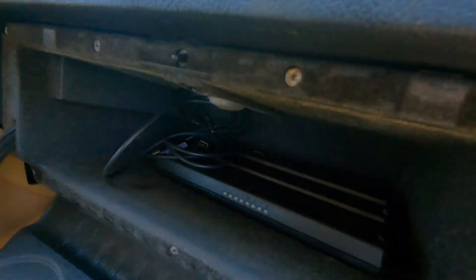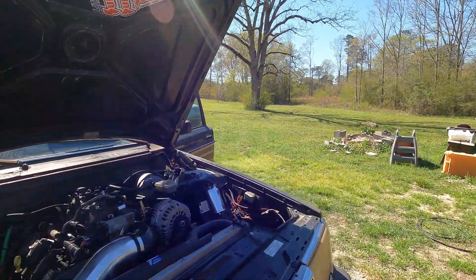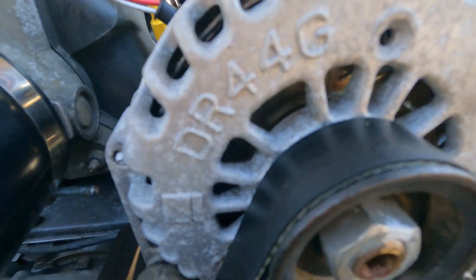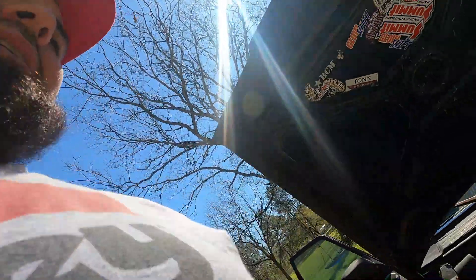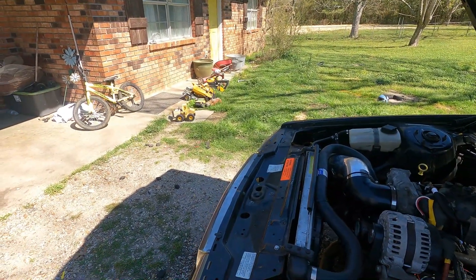One thing that a lot of people run into when they're running a system like the Holley Terminator — which is what I'm running in the car — maybe you're doing an LS swap and you have a Terminator setup, Terminator harness, but you still want to use the DR44G alternator that came with your engine. It has that two-pin alternator connector on it, and as you know, you have to have the factory GM ECU to control this unit. Or do you? There's a solution — you don't have to go back in time to the four-pin connector on the older alternators, which just has a feedback loop.